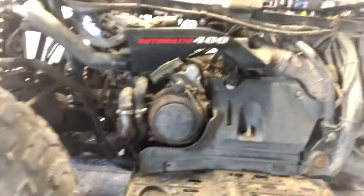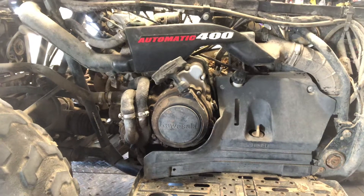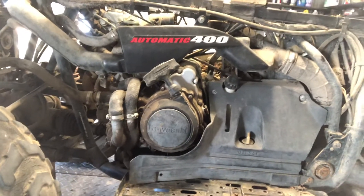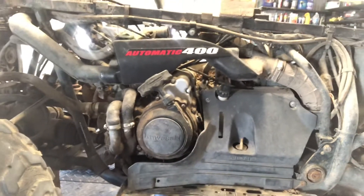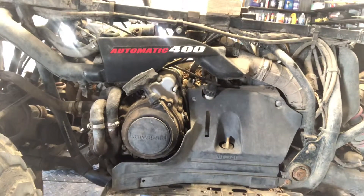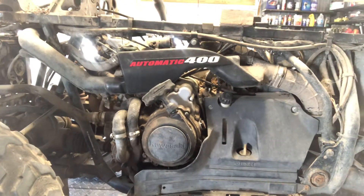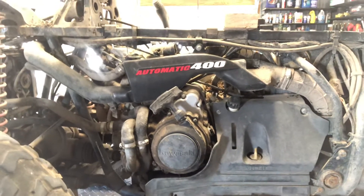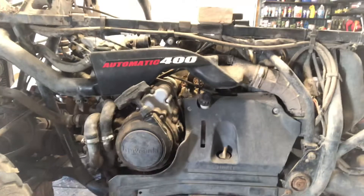You want to use a very thick oil — it's 80 weight 90 gear oil, gear saver. There are all different kinds of brands and a lot of auto parts stores sell them. You don't want to use automotive oil; you want to make sure that you use ATV differential oil. Comment below if you have questions on what kind of oil you need to use and I can give you some recommendations.